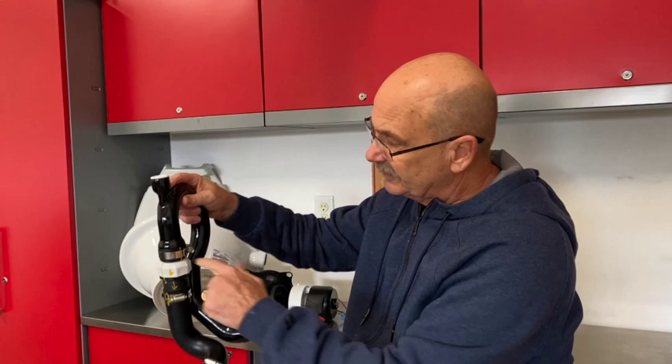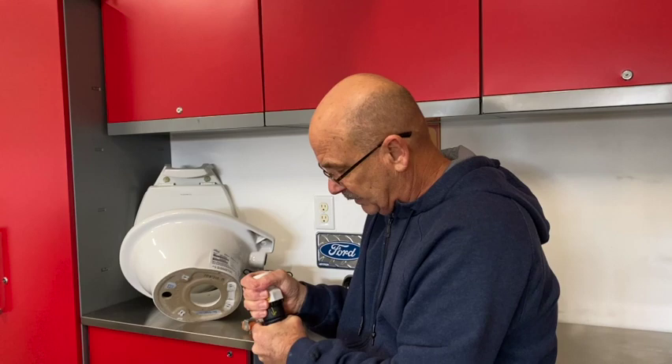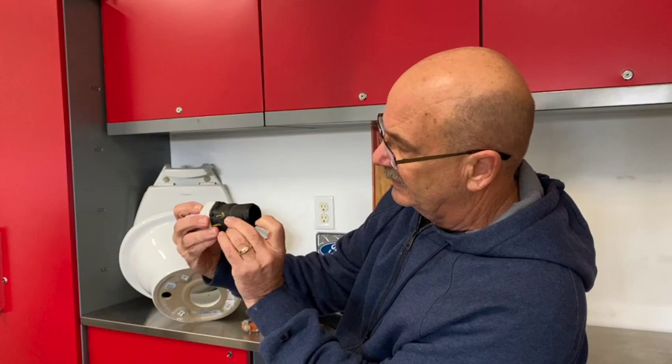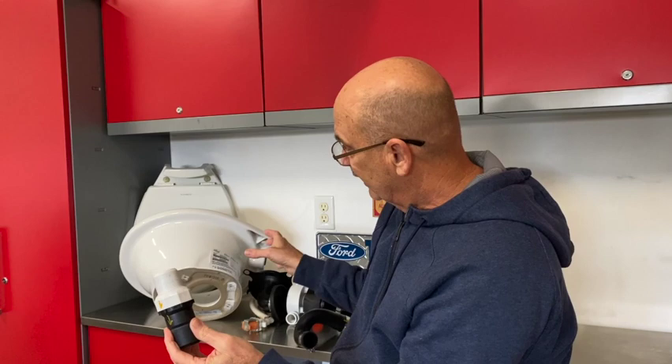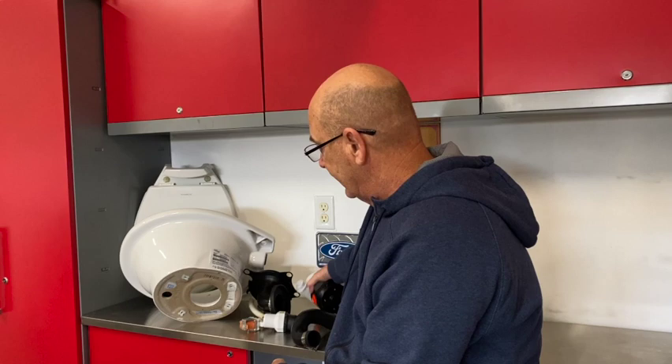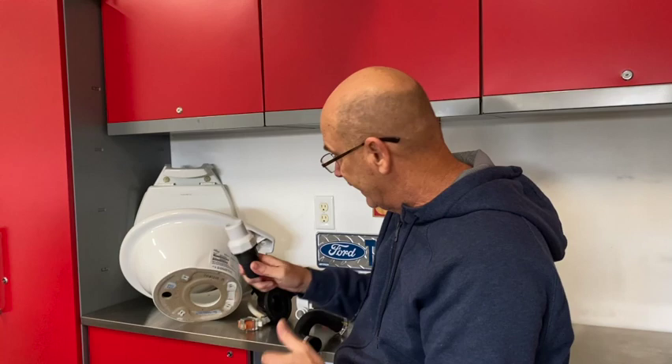At the end of the discharge tube is a one-way check valve — a duckbill type. You can see that right there. The more liquid that goes down, the better, because if it's not liquefied — if you're shoving too much product down there too quickly — it jams up the blades and goes out fairly large. It's going to get stuck in here and you're going to have a real bad day.